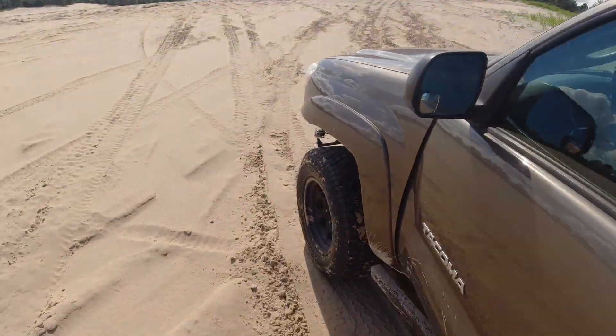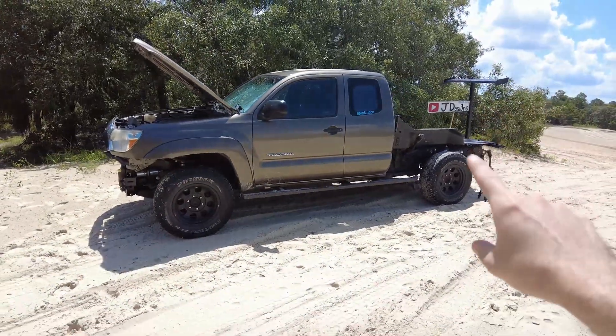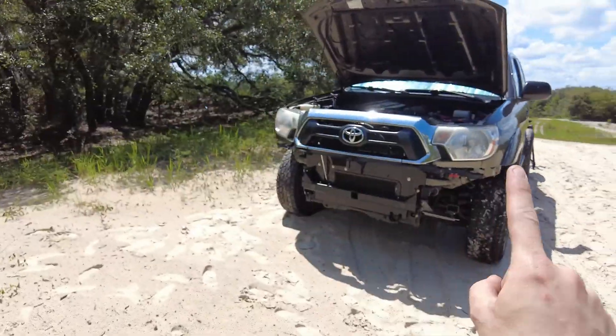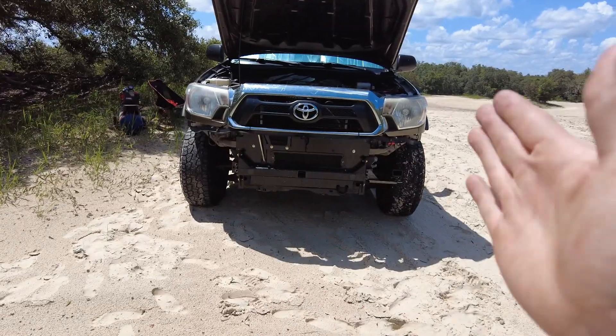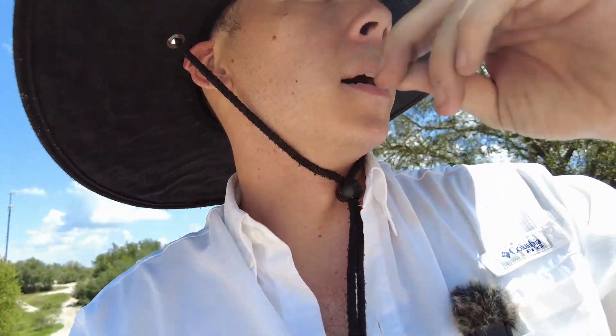Obviously it's an open differential Toyota — I do have a rear diff lock right here, but Toyota doesn't let you engage that in two-wheel drive; you can only do it in four-low unfortunately. So this is actually pretty cool — I went around and felt all the shocks and by far the two front ones are the hottest, which makes sense because that's where all the weight is. The engine and transmission are mostly supported by the front, and the rear really isn't dealing with much weight. Between the two fronts, the one on the driver's side is actually hotter, which also makes sense — that's where the battery, my weight, and the fuel tank are. The temperature difference between left and right front shock was so noticeable with my hand that I'm confident that one's actually hotter.